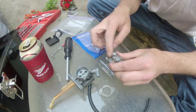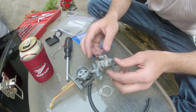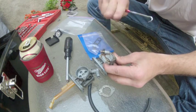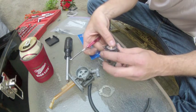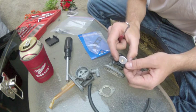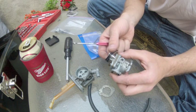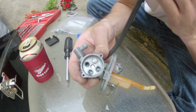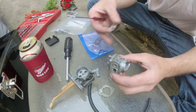Like I said before, new O-ring in there. There's a little steel spring that sits inside this bucket here, and it pushes the diaphragm closed so that piston can't come back. When the engine draws a vacuum through this, atmospheric pressure sucks this backwards and it opens that little groove inside, so it pulls it back like that. And it allows fuel to flow.